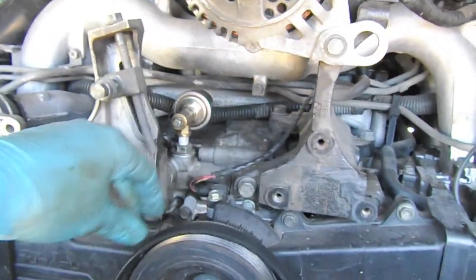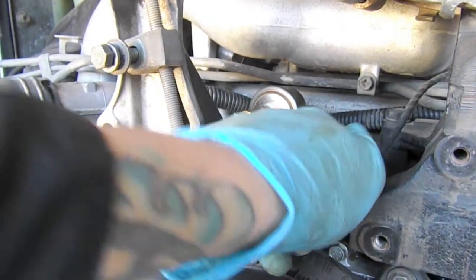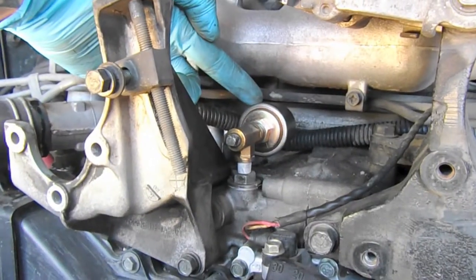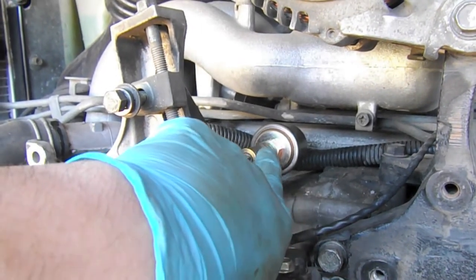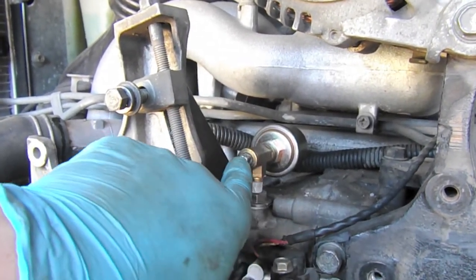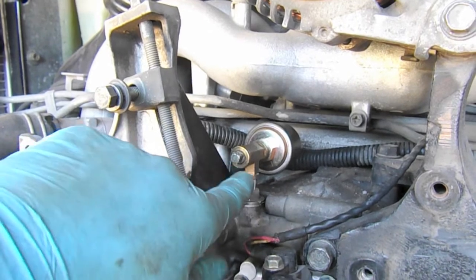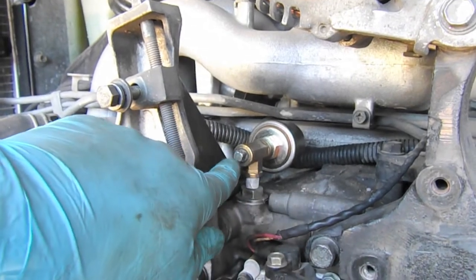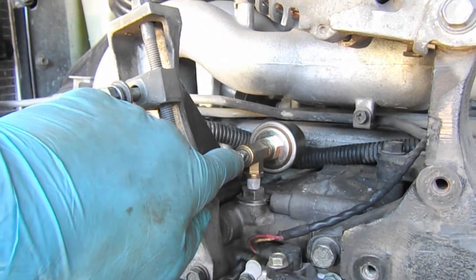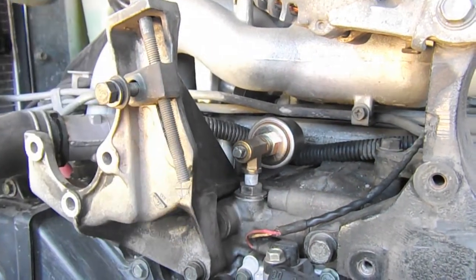If it is, I'm going to pull the oil pump out and take a look. I quickly removed the belt, which reveals the electronic oil sender for the eBay gauge. I just used the stock Subaru plug in a T. You could wire the Subaru pressure switch to have a dash light come on if oil pressure is really low, but at that point you're kind of messed up anyway. I'm going to use this port to plug a grease gun nipple flexible extension out to a gauge.